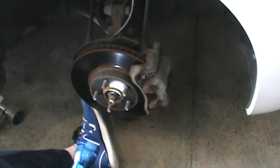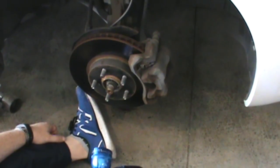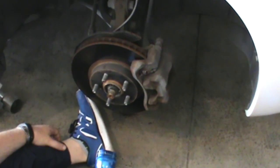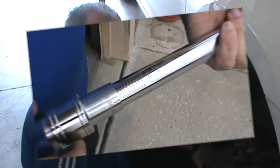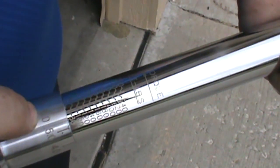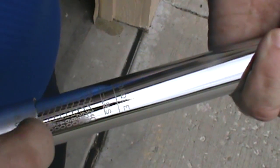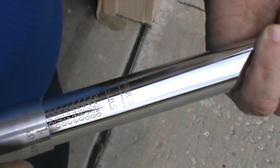While we did use a power tool to take the wheel off, you never put the wheel back on with a power tool — you need to do it by hand. On this specific car it is 76 foot pounds. We use a torque wrench to make sure we are at the correct foot pounds. On our torque wrench we have a graduation — this is the 80 point and this is the 76 point — we align this line with the center line, just below the 80 mark, and that tells us we're at 76 foot pounds. That is the correct setting for this car.